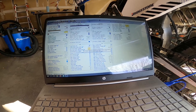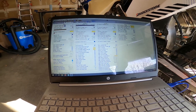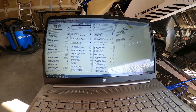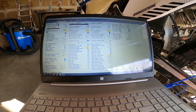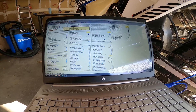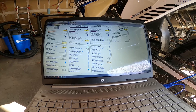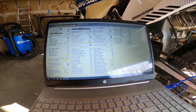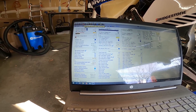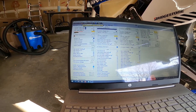Here are all my ECU settings from the playback I just recorded from this startup. It's hard to look at all those parameters while the engine's running because everything's changing by the second. This way I can start and stop things. You can actually watch the starter happen by the voltage drop — I'm at 12.8 volts, hit the starter, it drops down to 9 volts.